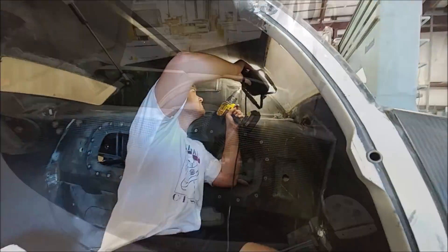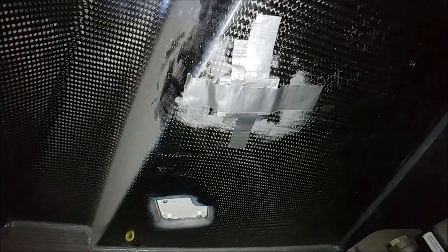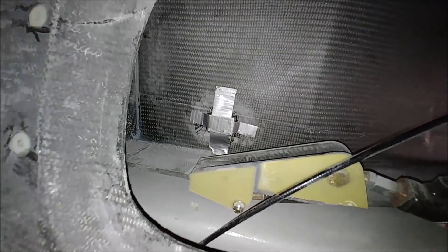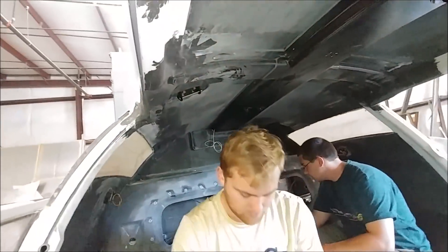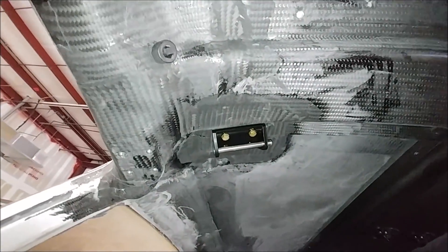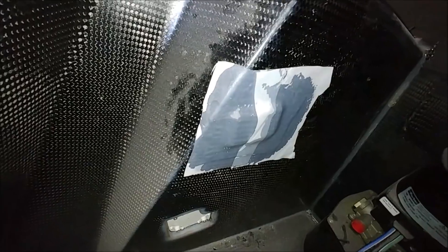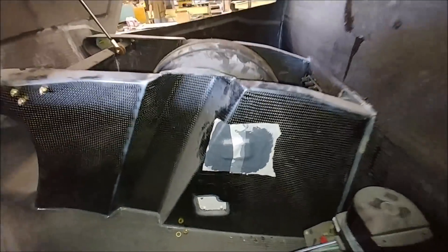Here's Keith in the fuselage exposing the holes for the hard point brackets for the seat belts, getting those ready so we can put the brackets in place. There are a couple more hard points — one for a little manifold for the landing gear hydraulics in the nose compartment, and another in the back where the hydraulics split out to the left and right gear cylinders. Keith is test-fitting the brackets — they don't need to stay in right away, but we did measure up for the seat belts and they'll be sorted out soon.